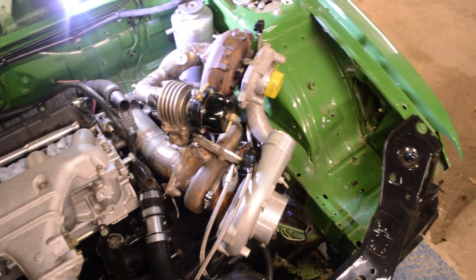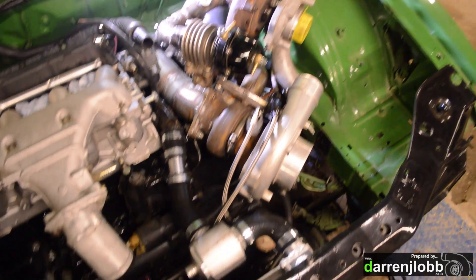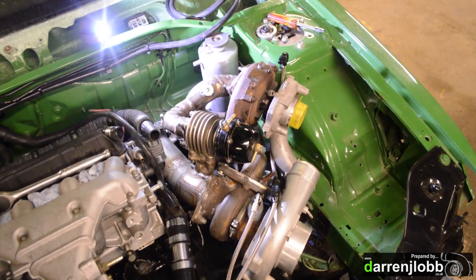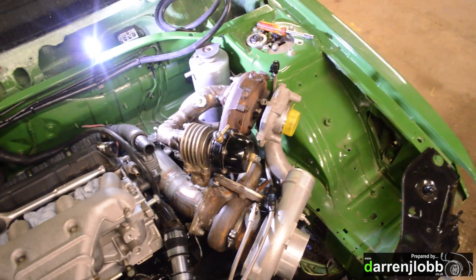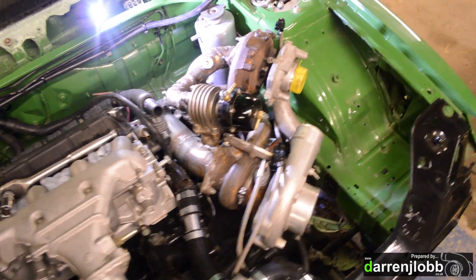We're just hooking up the high-pressure feeds to the two turbos. I'm going to be using the same two hoses that I made on the last engine — the ones we made up ourselves with the AN fittings. The only thing I had to get was just an adapter for the other VNT, because I did have one but I seemed to have lost it. For what a new one cost, it was quicker to buy a new one than it was to find the old one.